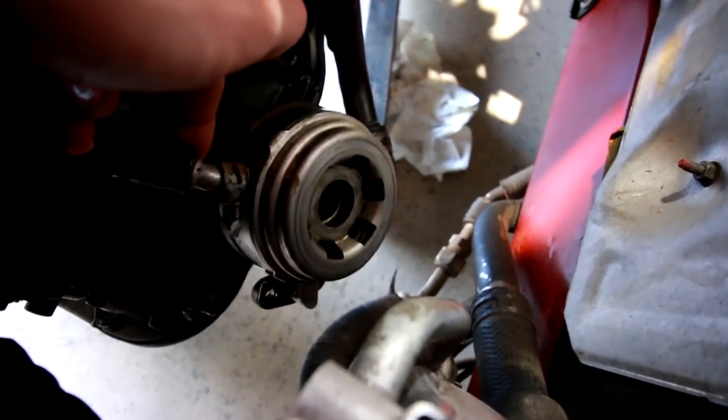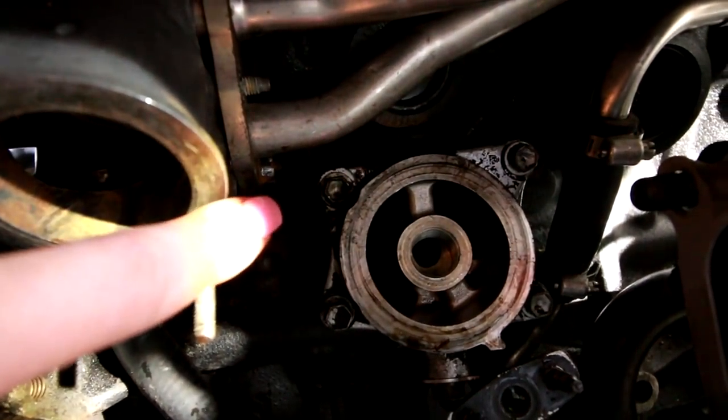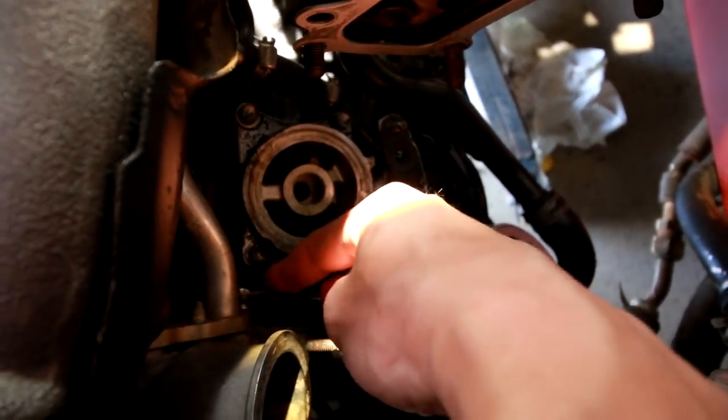I managed to get the oil cooler off thanks to one of my Instagram subscribers. I feel like an idiot — I didn't know the oil cooler separates into two separate pieces. It's a 30mm socket in the center and the thing comes apart. I thought you just had to unbolt the whole thing. So I got the oil cooler separated, got the top half off so I can gain access to this 10mm bolt on the back side of the coolant housing. And it's so rounded off I can't get a wrench on it. I've been fighting with it for the past hour, trying different ways to get a wrench on there — even hammering a wrench onto it. And I don't have a torch so I can't heat up the bolt.